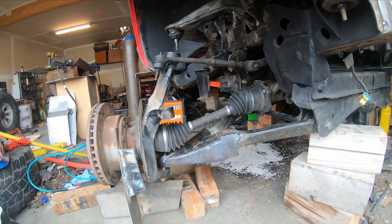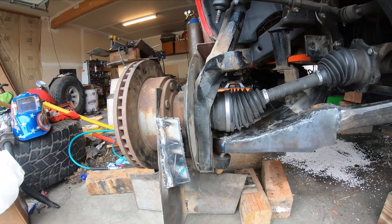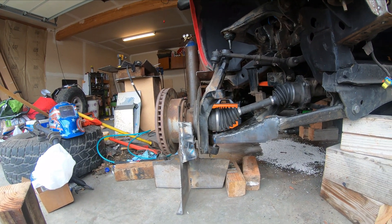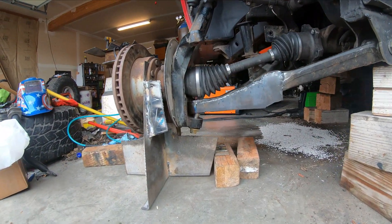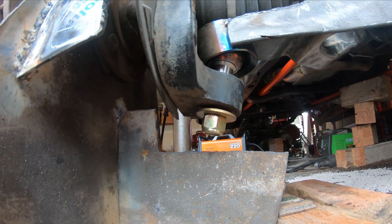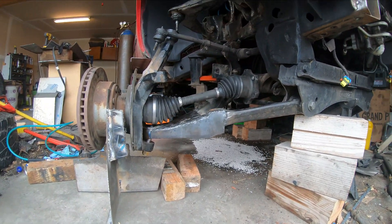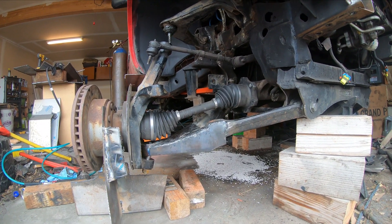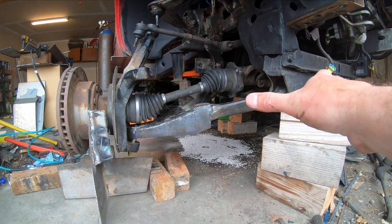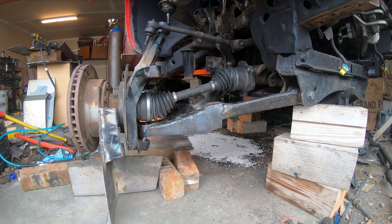This is quite a job — taking apart, putting back together. I can see right there it's touching just a little bit. I need to grind the cup a little bit to get full drop. It's still up in the air the way it's sitting — this may be ride height as in the angle of the A-arm. Looking underneath, that ball joint on the uniball still has room to move, probably about a good half inch for some more drop. I'm hoping for 15 inches of drop. The solid axle on some of these Cherokees will get like 10 inches of drop, but when you factor in the teeter-totter of wheeling where one tire goes up and forces the other down, they'll get more articulation than IFS will — that's the drawback here. But I hope to catch them and beat them in the flats.